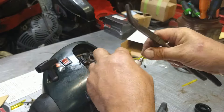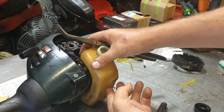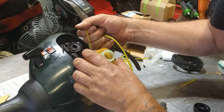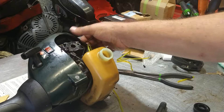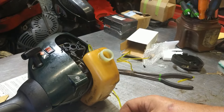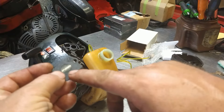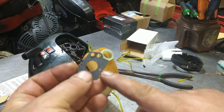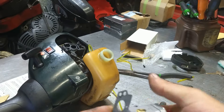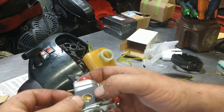That's good enough. Drop this into the tank — make sure it goes all the way down, about halfway down the tank, right on the bottom. If you have to, you can pull the line back up a little bit. This one has the gasket still on it — you can reuse these gaskets, not a big deal. But if you're going to use the new one, it's very important that you have the little hole built into it lined up — that's the vacuum line for your fuel pump that is built into your carburetor, so it has to line up with the hole on your carburetor.